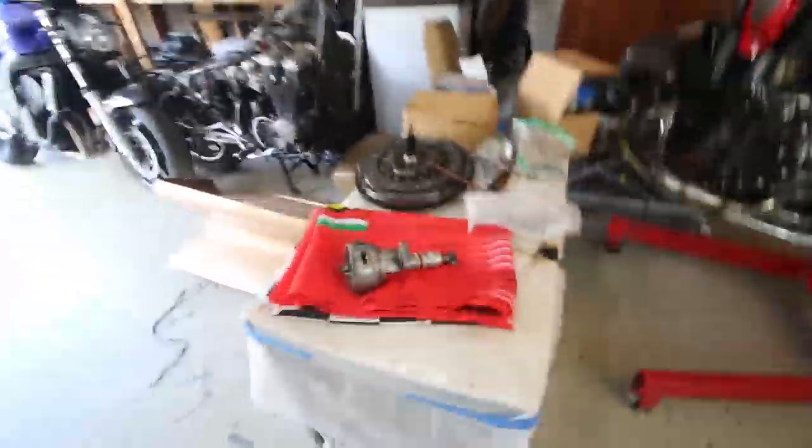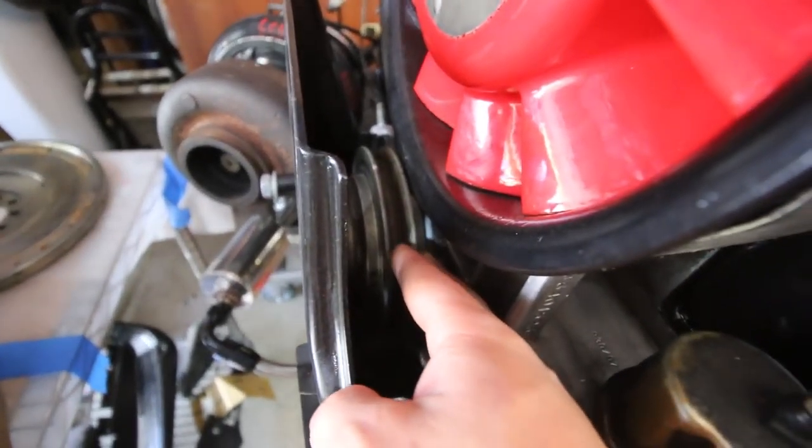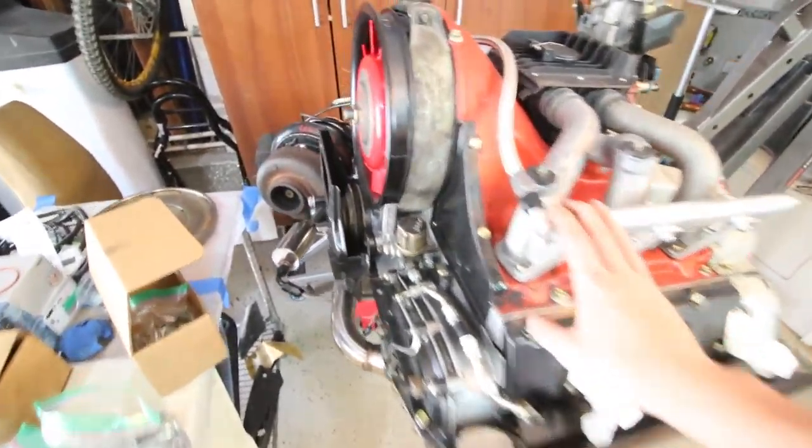Basically, if you live near San Diego or could hit us up on email and help us out with that, that'd be great. We're basically forced to get rid of this distributor — it's a big pile. That's holding up literally everything at this point, because if we're going to go with the VR and the tooth wheel we're not going to put this in the car, because then we won't be able to get the crank pulley off. So this isn't going in the car today like we had originally planned. We need a place to mount the EDIS module, we need to go get Crown Vic spark plug wires — it's basically just this big stupid messed up thing, and it's really eating into our 30-day challenge. I still think we can do it though.